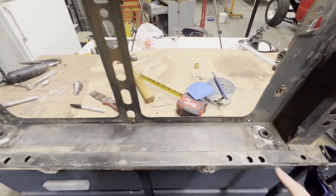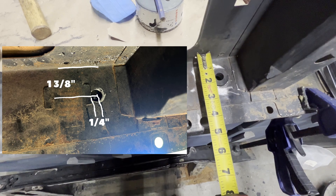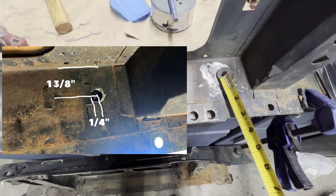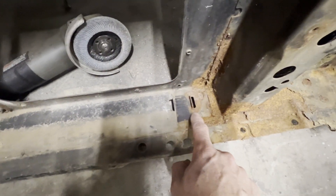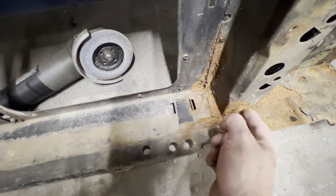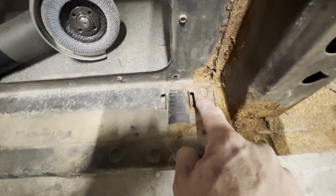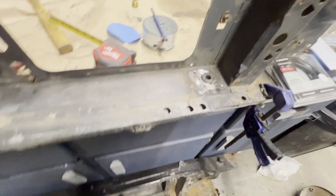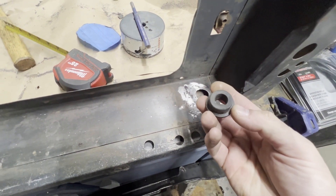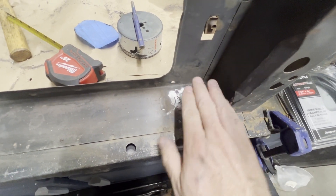Okay, here's where we're at. What I did is I measured an inch and three-eighths off the front of the radiator core support and marked my hole. I went a quarter of an inch over from that lip that I beat down, and marked that hole. This is an old core support — the battery busted and rotted this one out. When I beat this down and folded it over, I went over a quarter of an inch and an inch and three-eighths from there, and drilled the hole for my post. I came back with a bigger drill bit — about a one-inch hole. It's not pretty, but it's going to have rubber all the way around my radiator post, so it's going to be isolated very well.